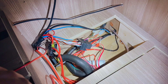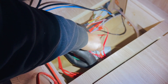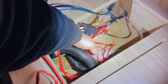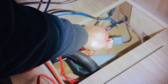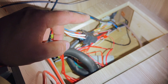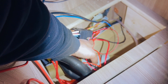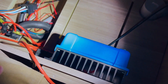Quick update on where we've got to so far. We're putting a relay here, which basically intercepts the line that was going from the engine battery to the electrical system. What this relay does is that when the engine is off, it allows the display on the electrical system to still report the engine battery voltage. We then put in this wire here — basically took it off that line coming off the engine battery — and that's going to the DC-to-DC charger.